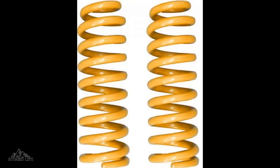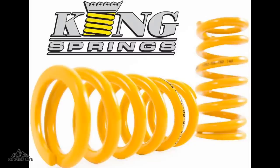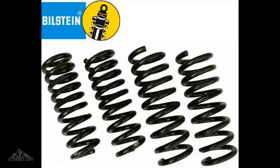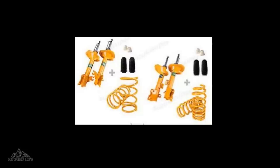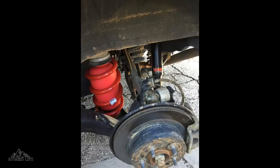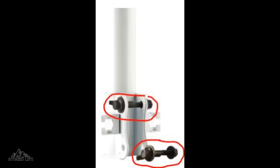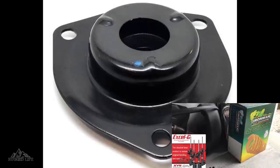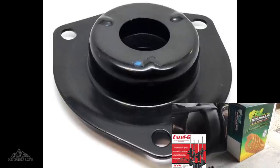There are a few options for suspension lifts ranging from 25 to 50mm or 2 inches. Different brand lift springs and struts are available, and some springs have load ratings — the higher the load rating, the more weight you can carry before the springs start sagging. Airbags are a better option to keep the vehicle level when loaded. You can use the original struts with any of the lift springs, however it is recommended to buy the caster correction kit to compensate for the extra height. Also make sure you change your strut tops when you change your struts. I have a video showing what springs and struts I installed, with a link in the description below.